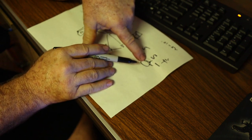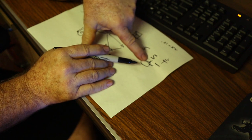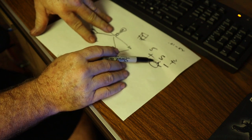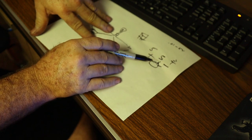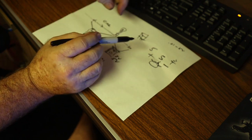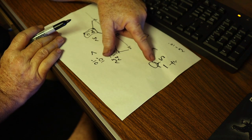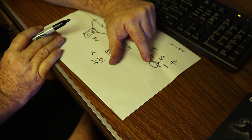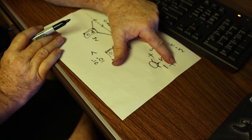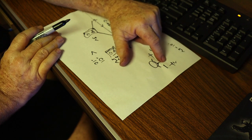Is the sensor going to be changing with temperature, position, or any of those types of things? The voltage drop test applies to the sensor as well. If you don't have five volts going into the sensor, you're going to have to find out where the five volts comes from and check connectors along that circuit. Same thing with the ground — a sensor can have a bad ground, so you have to trace out those circuits and figure out why.